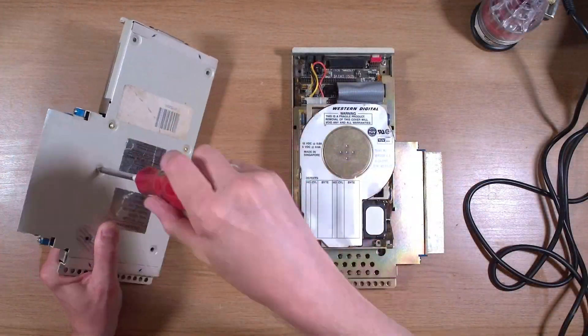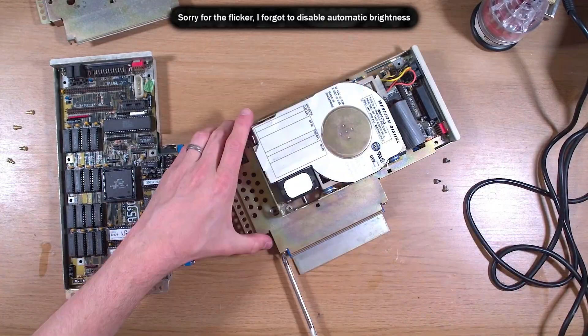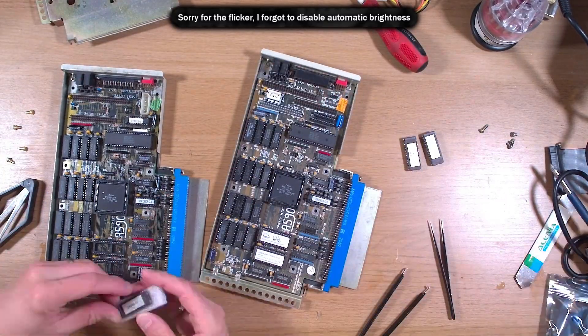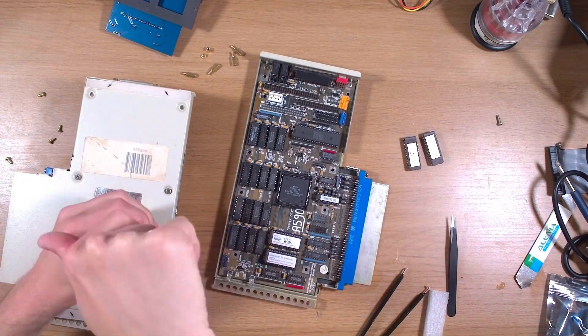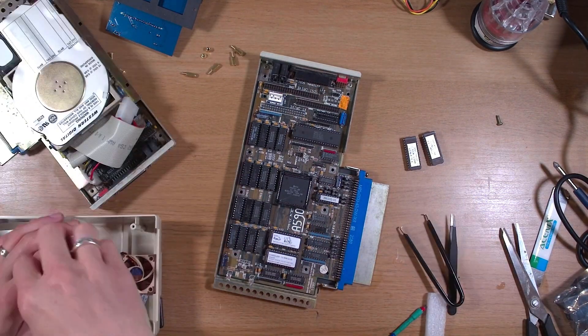Now, if you've been following this series, you'll know I have an A590 with a very early serial number that I've managed to restore to working order. I've decided I'd like to get the A590 as close to its factory condition as possible, so I've decided to remove the DMACC version 1 from the other A590 I have and put it in this one, whilst restoring its ROMs to the original 4.4. I've also swapped the blue SCSI and the 20MB hard disk around too, and I'll keep this A590 now for historical preservation and screw it back together.